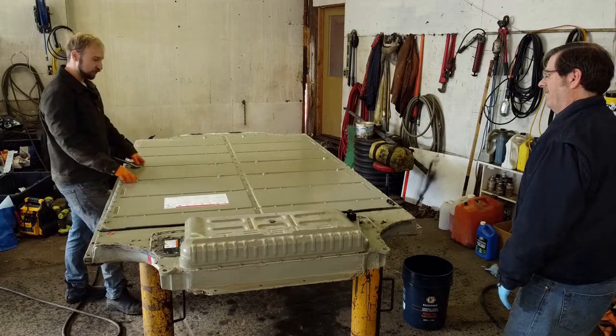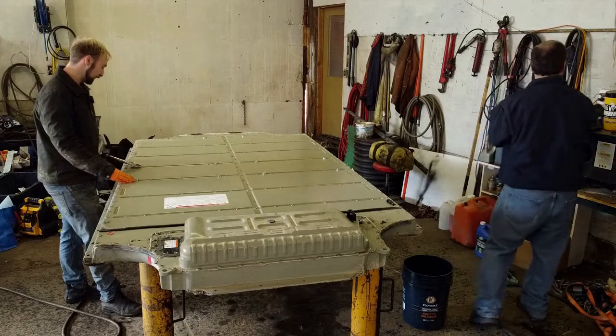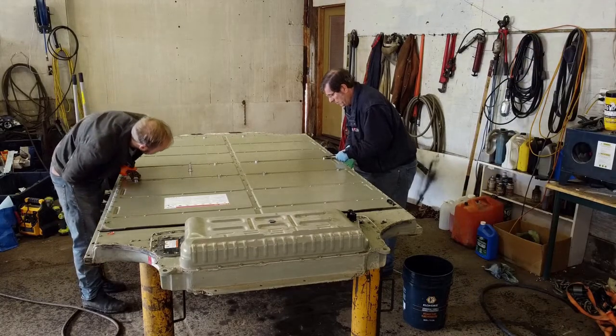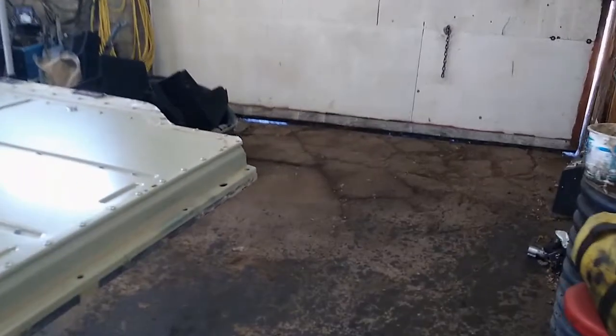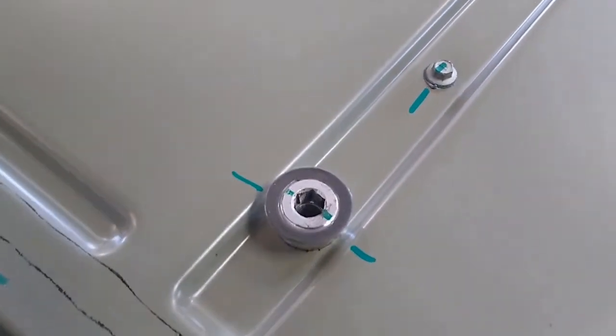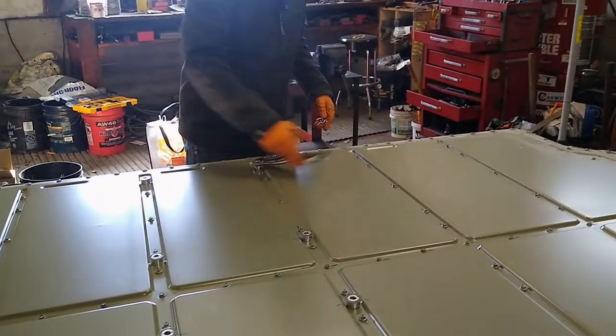We've got to take them off with an E-Torx. So from up top here, we just latch a vice grip on it and twist them out. And you'll notice there's some red on there, so these were put on with Loctite, the high strength Loctite. Okay. And you notice everything else has blue, so everything else is put in with the medium strength Loctite. And Tesla's lovely paint marks. They mark every single bolt in the car. Yeah. At least for this generation.